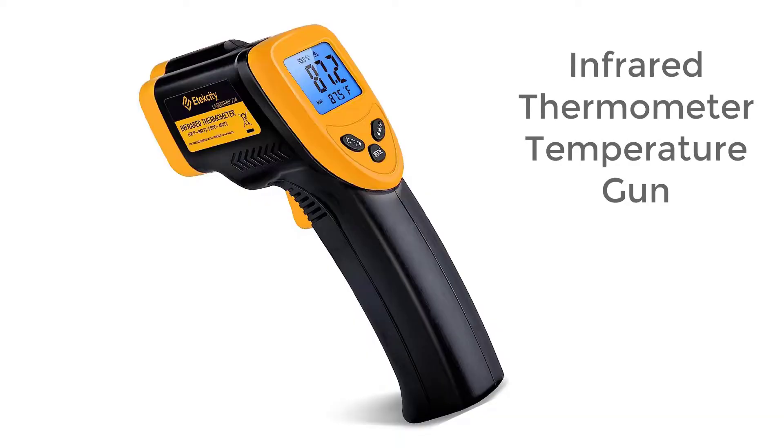Another method — and it's a decent one — is to take an infrared laser thermometer and point it at the exhaust system at different points. The temperatures on your catalytic converter should be around 500 to 800 degrees Fahrenheit. They can range up to 1,200 and still be working properly, because it depends on the vehicle, how big the engine is, and how small the exhaust system is. But overall your catalytic converter shouldn't be more than about 1,000 degrees at idle after it's been fully warmed up.